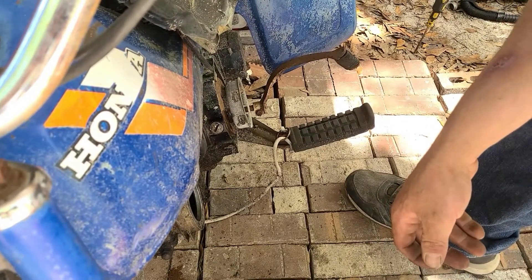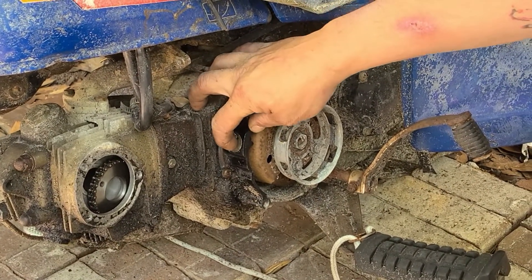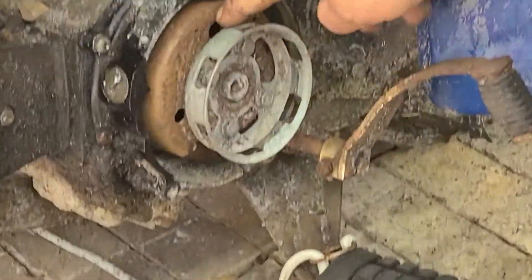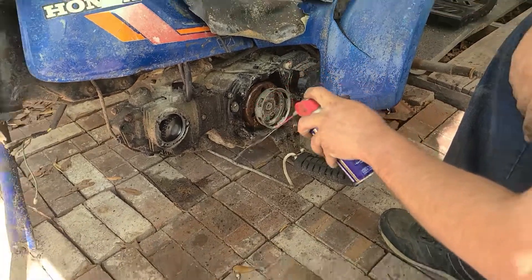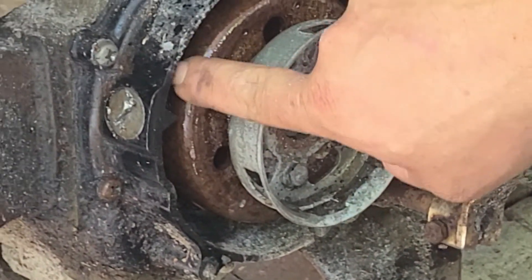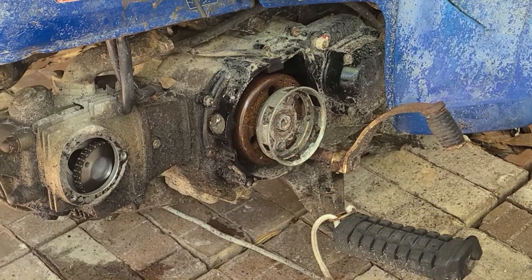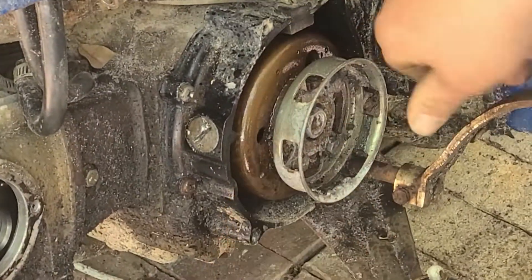Let's see if I've got a better flathead. So instead of getting this inspection port out — which I cannot — I might be able to weld to it depending on if it's aluminum or not. But I'm not even going to worry about it because we just found the timing mark and the fire mark on the outside of the flywheel. So I'm going to clean it up. You can see this little arrow here. At first I was looking at the fire and the T mark on the inside, and then I realized a little further down, behind the pull, you can see an F and a T right there. We'll clean it up. Okay, that's it right there — you can see it.